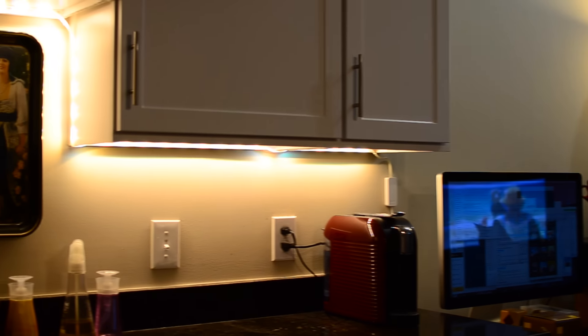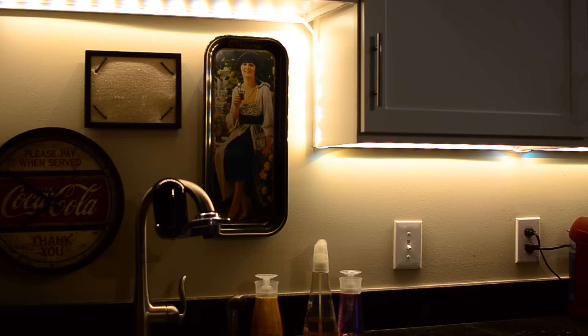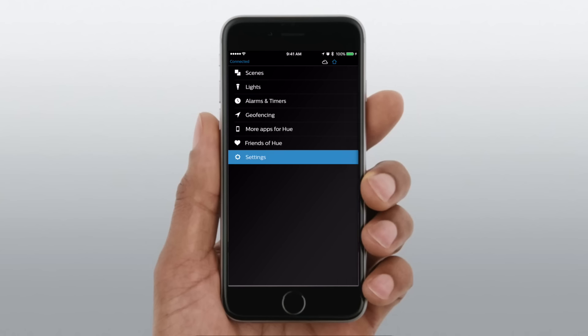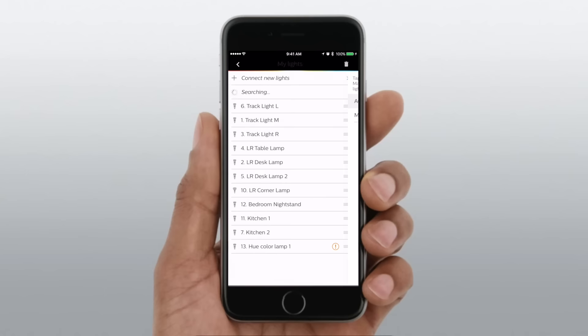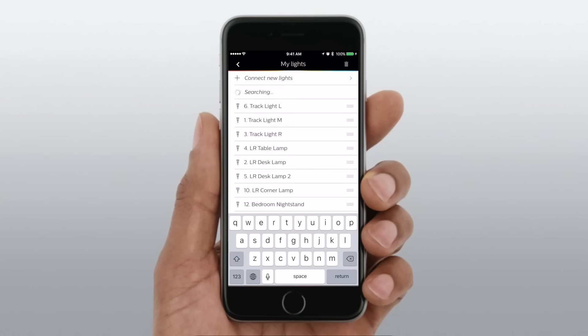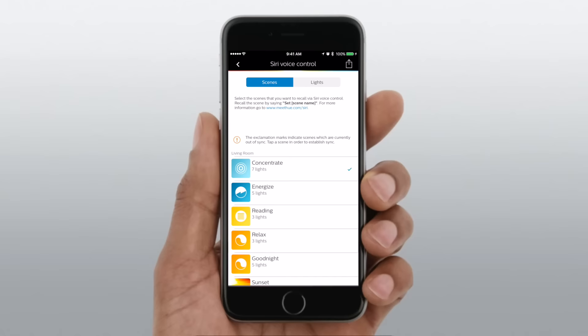Once it's all in place, you can see how it looks. One big change is that it went from 120 lumen output to now 1600 lumen output, which is a huge change. It is significantly brighter than the last generation model, even if it's hard to tell on camera because it just blows out. To hook up to the Hue app, go into settings, go to My Lights, and either do an auto search or a manual search where you enter the serial number — found on the back of the power adapter. Note that you do need a Hue bridge to use this light strip, so you must have that starter kit or bridge already in place.